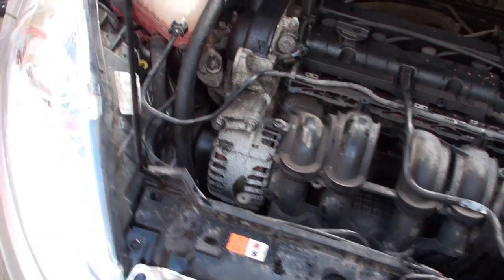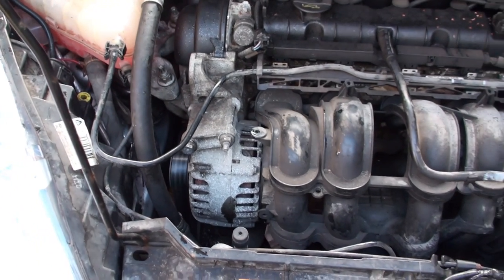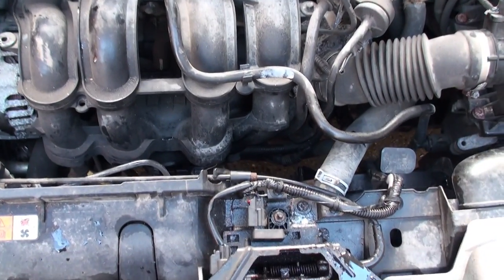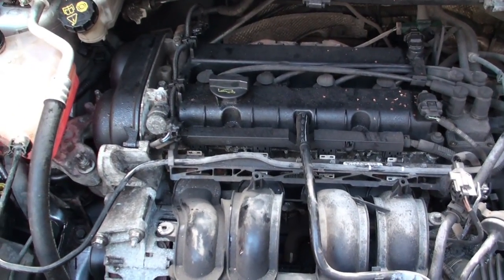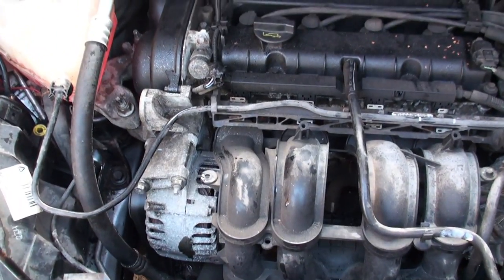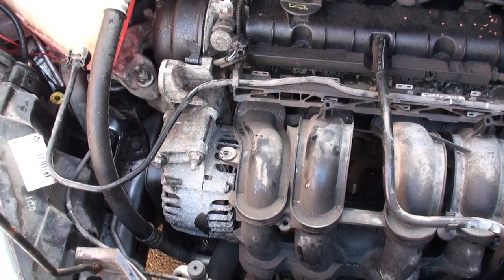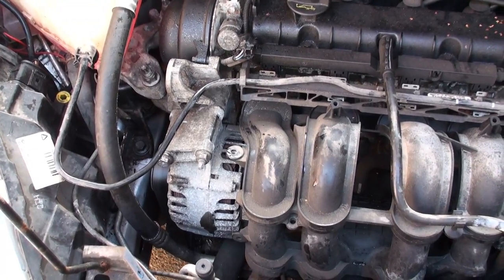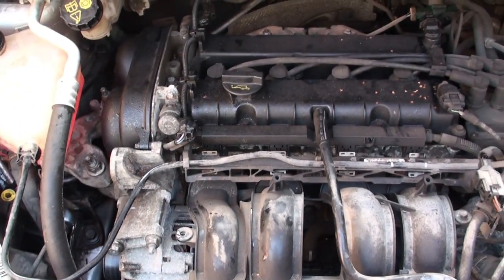She's all back together, just ticking over now. It's been raining so there's a little bit of water on the engine. New oil, put the old coolant back in filtered. Remember to put the timing pin blank plug back in. New auxiliary belt which you stretch over — there are plenty of videos online showing you how to put that belt on. It seems to be running fine, everything's okay, so we're on the road. I hope you found that interesting and it might encourage you to have a go yourself. It's a bit daunting the first time — that nut on the end of the crankshaft is pretty tight, so you do need a good quality 18mm socket and a long breaker bar. Subscribe and I appreciate it — hope you enjoyed the video and found it useful, thanks.